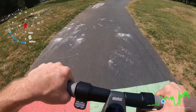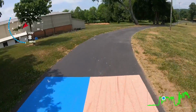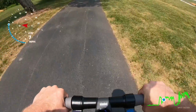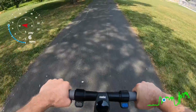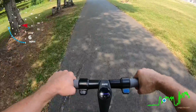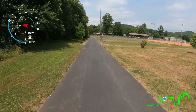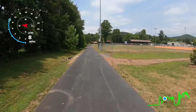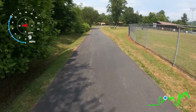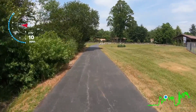So what's going to happen is, when I let off the throttle, let's say I let off the throttle now and I'm coasting downhill, it's going to do very minimal energy recovery unless I'm at 19 miles per hour. I have found if I'm at 19 miles an hour and I let off the throttle, it's automatically gonna start doing some regen to keep me from going faster than 20 miles per hour. So I think that's a pretty good safety feature, and keeps you from running away, going downhill. I've never had the occasion of going down a steep hill and the regen brake not being able to stop me,